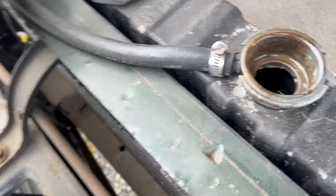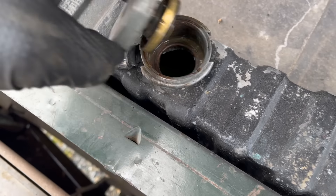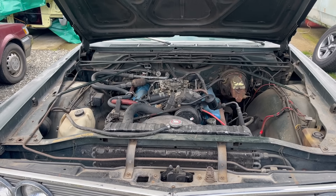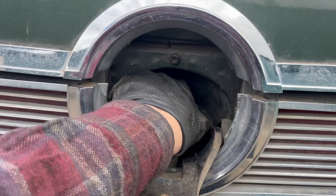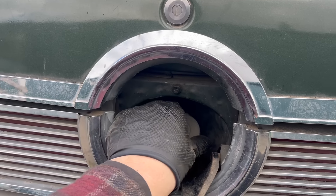Well, I like our chances here because it's full of green coolant and there was pressure in there. Of course, it's got the original points — we may well have to scrub those, but we'll find out in a minute. This car definitely hasn't run in a couple of years, but we're not really sure what a couple means. It could be four or five. According to the smell in here though... yeah, it still smells like gasoline, so hopefully it'll burn.